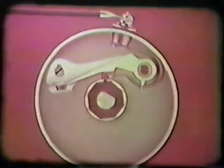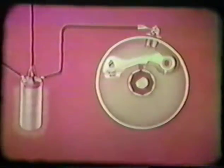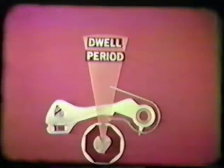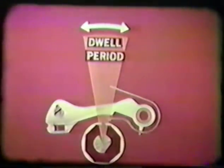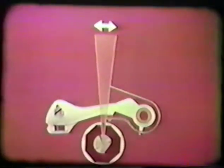After the plugs and distributor have been examined, check and adjust the distributor's breaker point dwell period. As the distributor's cam turns, it forces the point assembly's rubbing block to move up and down. This action causes the breaker points to open and close. When the points are closed, a charge is built up within the coil; when they open, the charge is released, causing ignition. The period during which the points are closed for each ignition cycle is called the dwell period. The length of this period, measured in degrees of cam rotation, provides for the proper voltage buildup for maximum spark intensity. A period of dwell that is too long or too short can adversely affect engine performance.